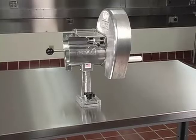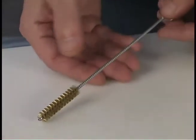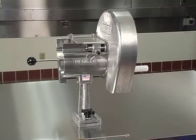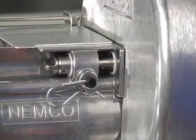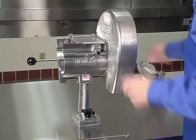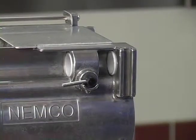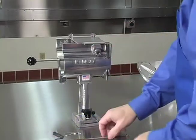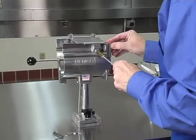You will want to periodically clean the shaft lock bore with the brass brush provided with the Easy Slicer to assure that the shaft lock assembly turns freely. To remove the shaft lock for cleaning, rotate the shaft lock assembly to the left to release the rotary slicing assembly. Slide the rotary slicing assembly out of the trough and leg assembly. Remove the guard. Pull the shaft lock pin to release the shaft lock. Pull the shaft lock out of the trough and leg assembly. Use the supplied brush to clean the shaft lock channel.